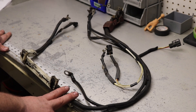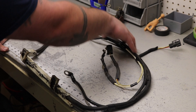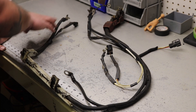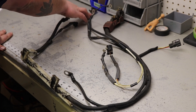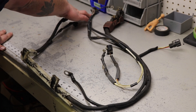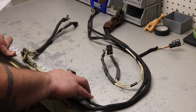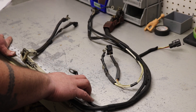We will start with the battery positive cable. It is going to connect to your battery positive terminal and actually runs down along through under your engine and back out to the starter post. Next is the negative battery cable. It is going to connect at the battery negative post, run down through, and it actually exits here and terminates at a bolt that bolts to the engine block.